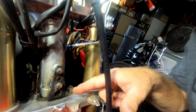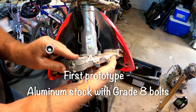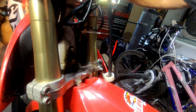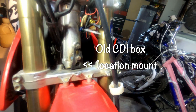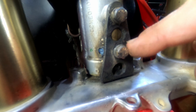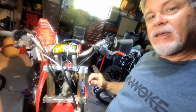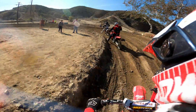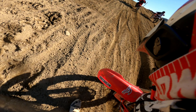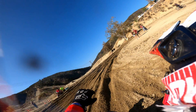While I'm here I'll talk about this. We had issues, and now we've gone with a steel piece — kind of ugly because I haven't painted it yet, but it's very solid. I took it over to Mr. Smoky and he actually tack welded it on both sides. As you know, this bolt here sheared off despite being a grade 8 bolt, and boom — I think we found the mystery to the crash. I believe what happened is it broke the old mount, allowing the front wheel to swing over, it knifed into the turn, and I went over the handlebars. That's my excuse anyway.